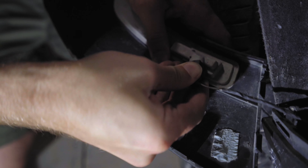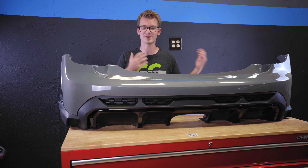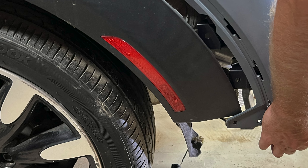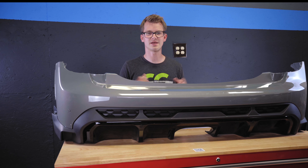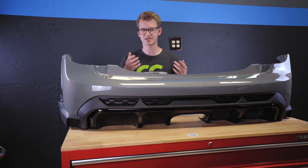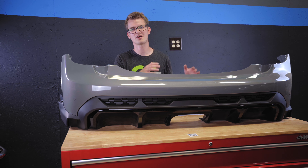There's an indicator light here so just be careful of that — push it down and it comes right off. I actually took off the bumper a few weeks ago because we were test fitting a different bumper. Turns out it doesn't fit this car because I got the bumper for an F56 instead of an F55, which is the four-door hatch I have. So if you go to order this, make sure you get one for an F55. We also noticed the old bumper had a tow package, so we're going to take that apart and use the cables for the parking distance control retrofit later.